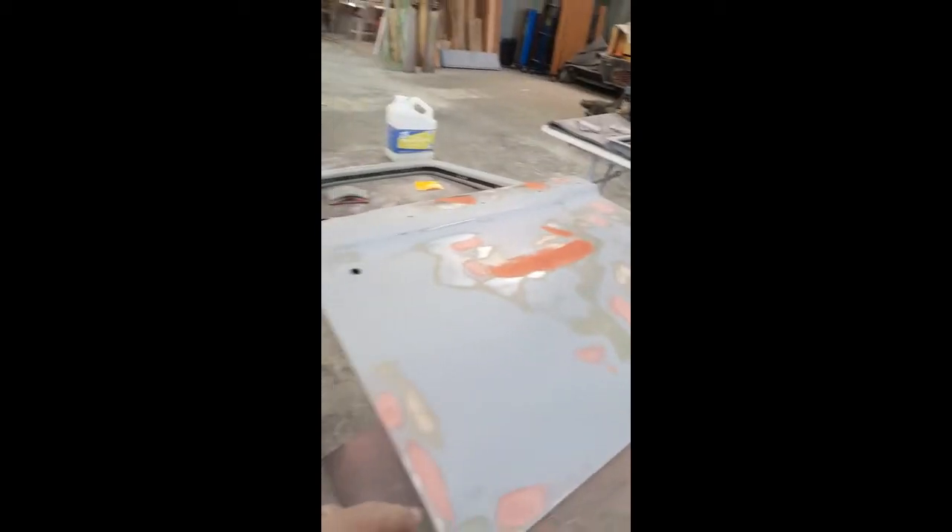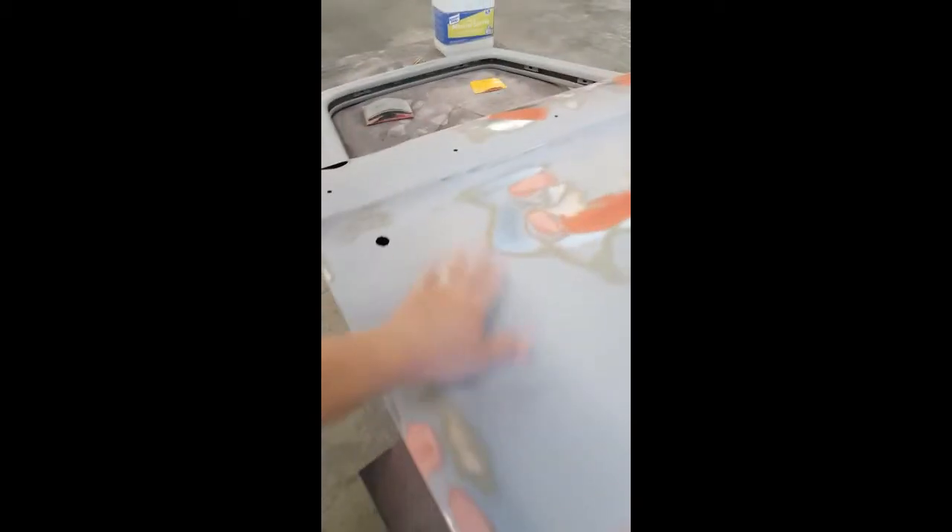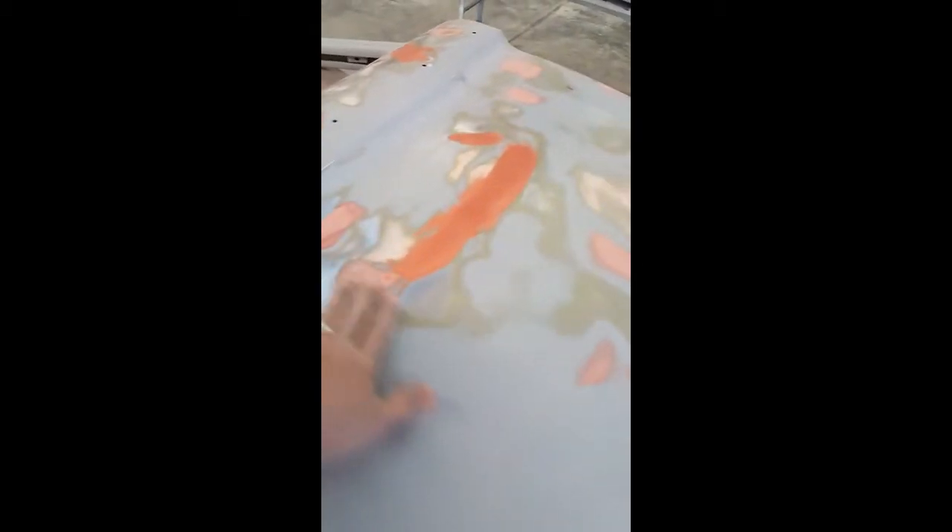In summary, I've block sanded the hood with those blocks, spot puttied all the little imperfections, and reprimed it. Done the same thing to this fender. We're on these two doors now. It's too hot — even at eight o'clock at night it's still too hot to prime; we're outside the temperature range for the materials. The passenger door was pretty banged up with lots of little spots of body filler already on it. We're just finishing that up and she'll be glass smooth when done.